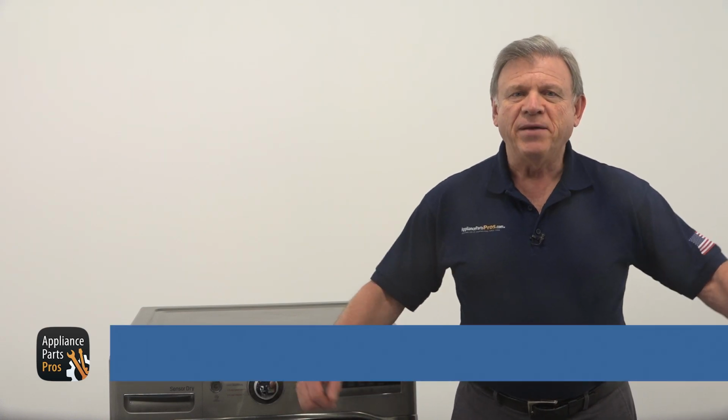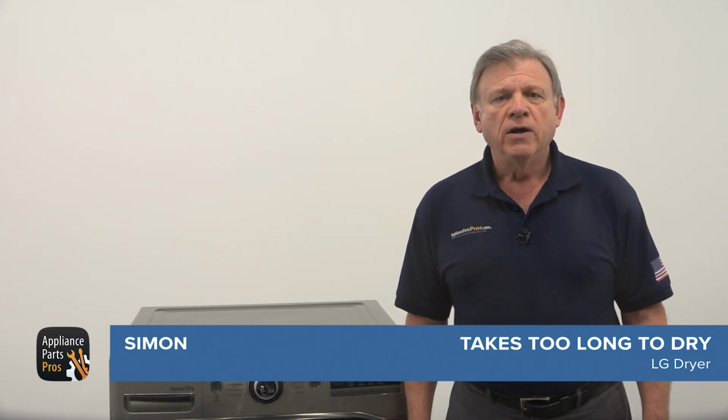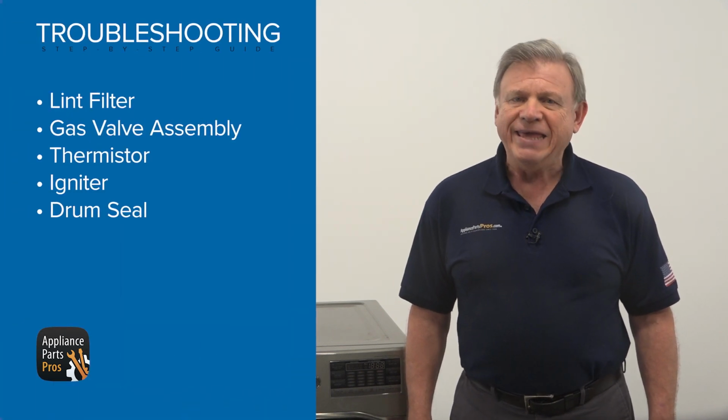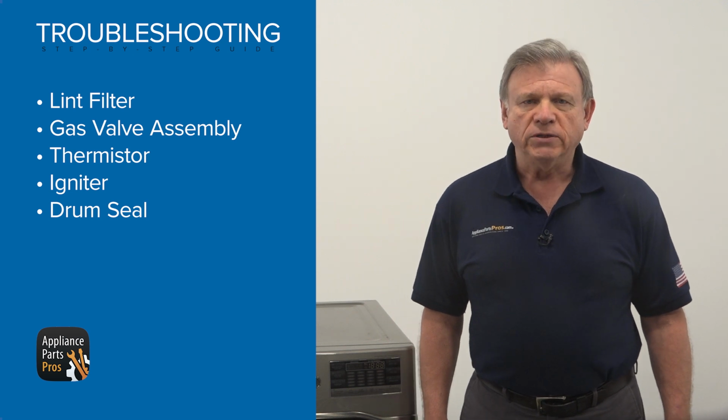Hey there, it's Simon. Today we're tackling a common issue with LG dryers that take too long to dry your clothes. We will walk you through inspecting a few key components to get your dryer back up to speed. Things like the airflow is not restricted behind the dryer, that you are using a rigid 4-inch pipe vent with a limited amount of 90-degree turns, and the lint filter, gas valve assembly, thermistor, igniter, and drum seal.